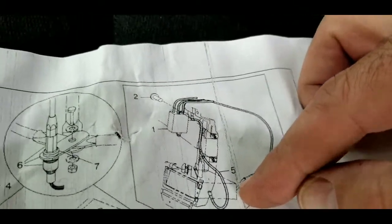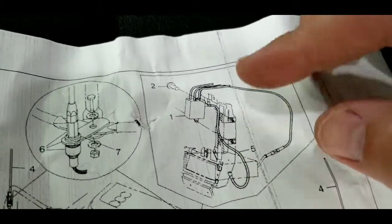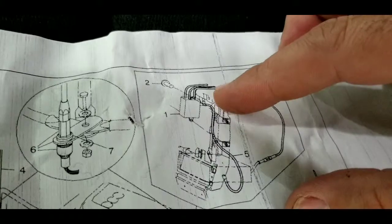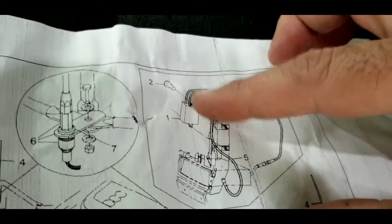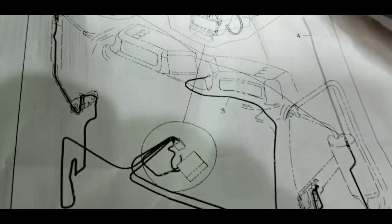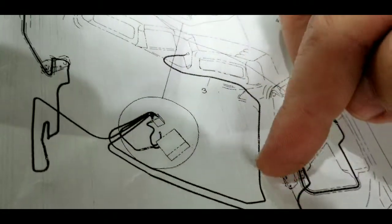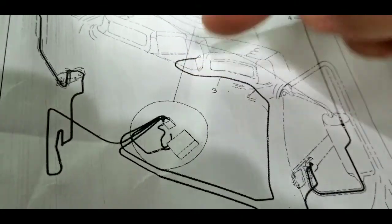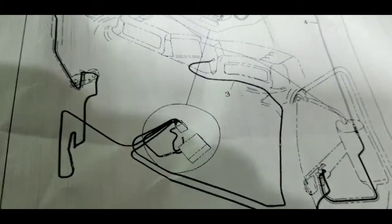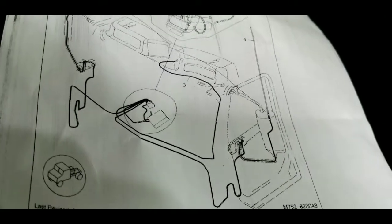So I'm getting horrible radio reception on the AM/FM radio, and on the CB radio it sucks something awful bad. So the problem is these boxes suck. From the box, you got coax that runs out up the A pillar and to the upper CB cabinet to plug into the back of your CB radio. This is way too much in my opinion. This is why the system sucks on Freightliner.